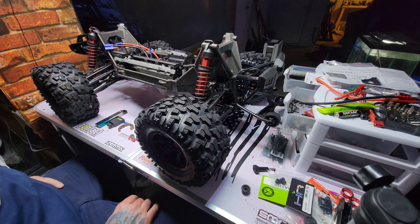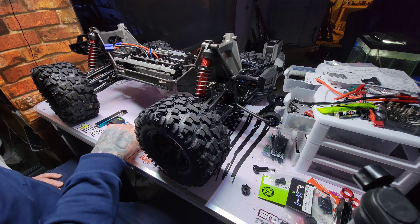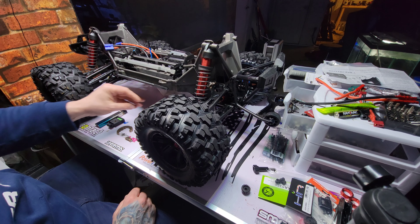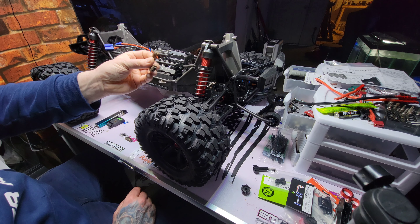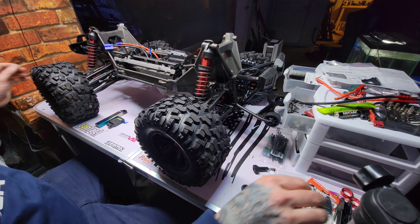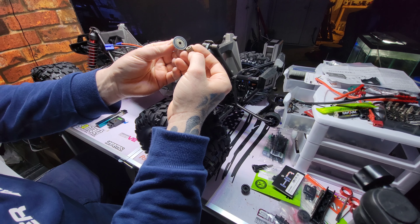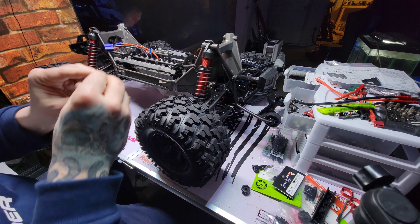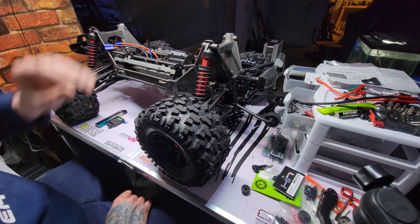Nikizuna just bought a new X-MAX too, and his second run out he blew the servo and one of his fans quit working. The first blow-out was my fault. Second time around I put the stock 46 tooth on and this thing grenaded inside. On my second run, that two-piece driveshaft sheared the little pin that goes in the middle of that bearing. I don't know when that happened — I'm guessing it was when all the catastrophe was going on, but I didn't find that out until I put the stock gearing back on.